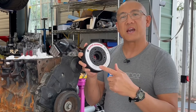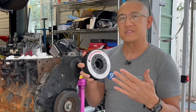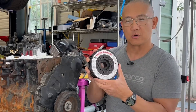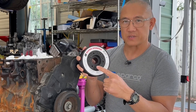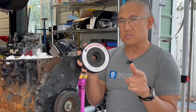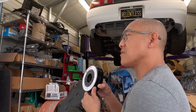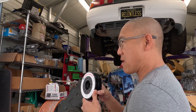So how does the ATI Super Damper really work? As your motor runs, there are forces acting on the crankshaft, essentially trying to twist it like a noodle. The ATI Super Damper counteracts those twisting forces. It's made up of a front cover with a metal inertia ring surrounded by elastomer bands, which reduces those twisting forces. This reduces the vibrations and harmonics within your motor, and therefore it's a power adder.